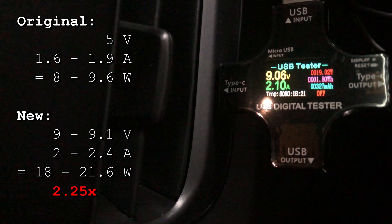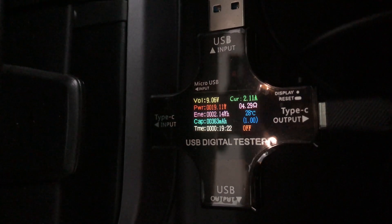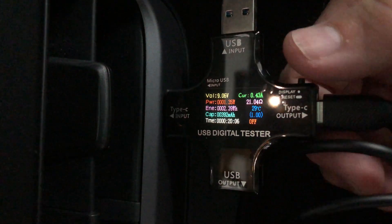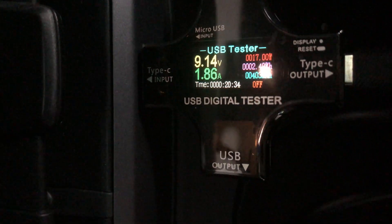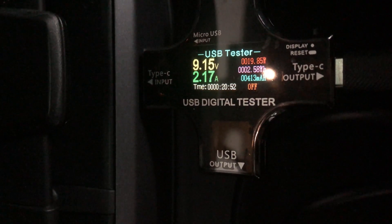So not quite as fast as the theoretical 27 watts that USB-C can provide, but I'm happy with the improvement. As more and more devices start using USB-C cables and requiring higher charging power, you'll be glad to update the ports from USB-A to USB-C. This was a super easy modification to the car. If you can get a good price on a used replacement part, go for it. I got mine for $50 plus $22 for the cable, for a total of $72, which is not too bad for this upgrade. That wraps up this video for upgrading the rear USB ports from Type-A to Type-C. This retrofit for an older Model 3 is one of the easier jobs you can do for faster device charging, and it only takes a few minutes to swap out. Thanks for watching!